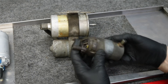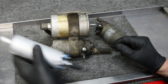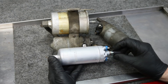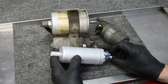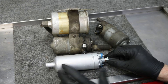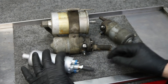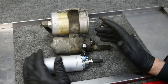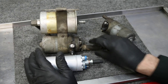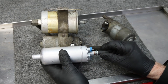These pumps are no longer available — you cannot buy them new. Most people have opted to use a pump out of the newer K-Jetronic cars, 1976 up to 1985, like the 450 SE, 450 SL, and 380 SL. These pumps will work, but you're going to have some adapting problems: the pump is longer, the fittings are different, the hose sizes are different, and you've got to get a banjo fitting. It's a bit of a hassle because you generally have to get new hoses — look at how bad this hose is.